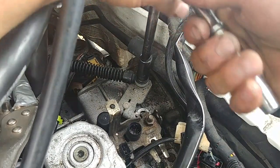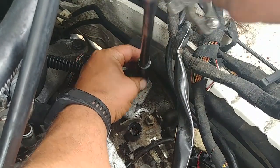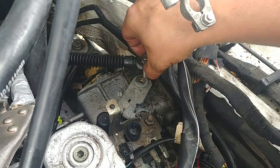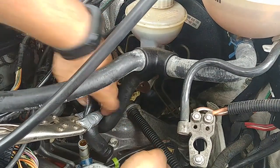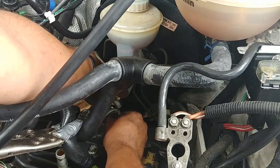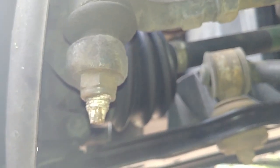There's a shifter cable bolt on the shifter arm — take it all out and put it back so you don't lose that bolt and know where it came from. Pull the holder clip, remove the shifter cable, and pull it out from the bracket. Disconnect the speed sensor — it's on the bottom of the transmission, it's hard to film but you have an idea.